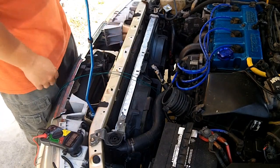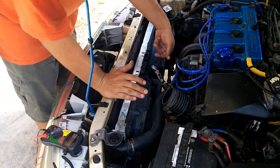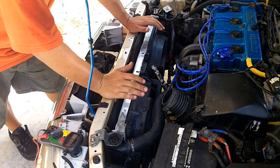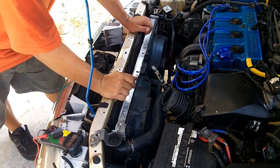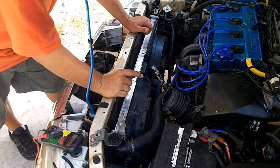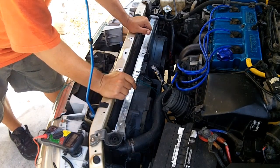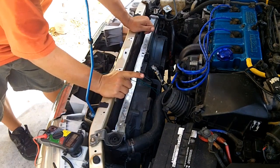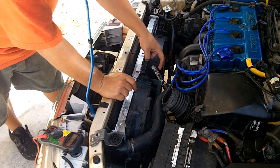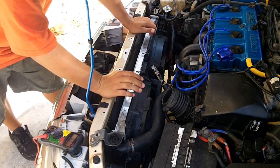But it's just a dumb switch, meaning there's no relay involved. It's just a switch based on mechanical position, which uses battery voltage. So with that in mind, we can introduce a 12 volt relay and relay the backup switch into that loop using jumper pins. Just by using jumper pins in one relay, I'm hoping to take this entire switch out of the loop. For a manual transmission, you don't need anything but park and reverse.